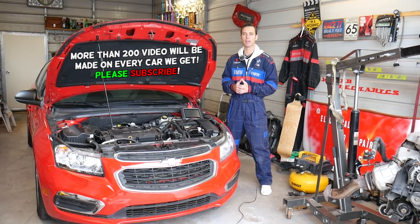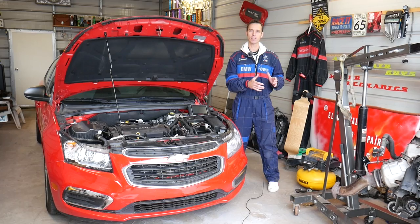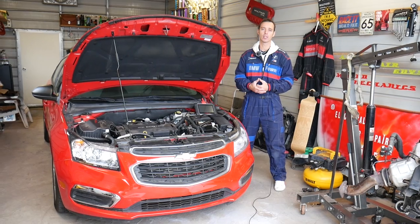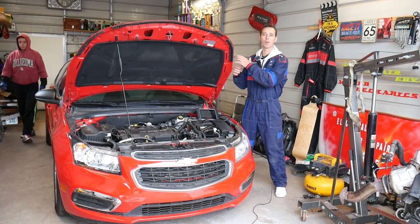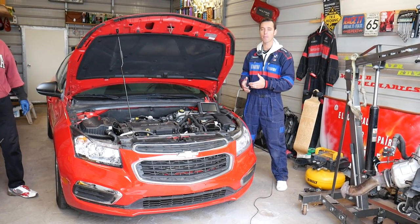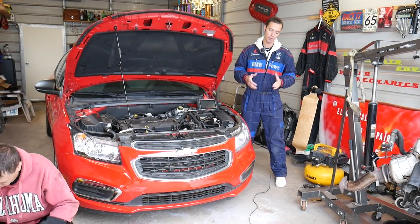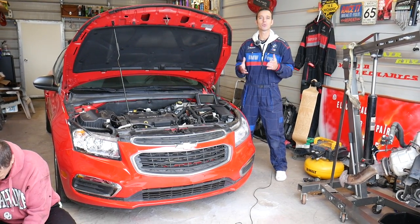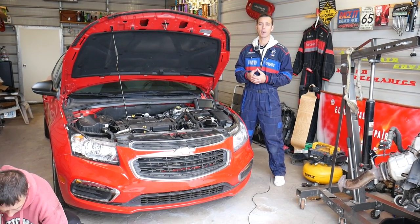We will explain that and what we use. Sometimes you'll get a message that the front left tire is flat, which means either the tire is flat or the TPMS sensor is not working and there is no communication with it. But instead of being the front left, it could actually be the rear right, and the computer will not know that. We'll explain why. This can happen when you have your tires rotated and people don't re-learn the sensors. As a result, it may tell you it's on the front left side, and you'll replace that sensor and find out that wasn't the case. You don't want to waste your money and work.